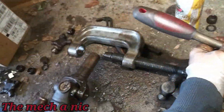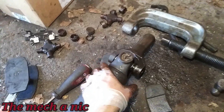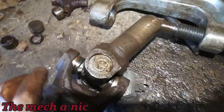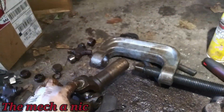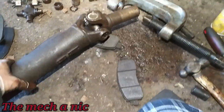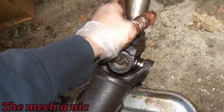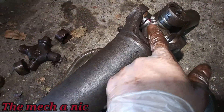There was no damage done to anything because I was using an impact gun to take it apart — sometimes you need brute force for that — but as far as putting it back together, nothing but hand tools. You don't want to force any of this stuff; everything should go in smoothly. Because I was using hand tools the entire time to put everything together, no damage was done. I was able to fix the needle bearings and put it back together. You can now see we have the clearance to put that circlip — or C-clip, whatever retainer clip — in. Definitely a learning experience. I'm all done with this side; everything moves nice and smooth, nothing is binding at all.